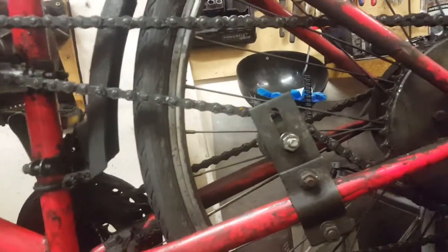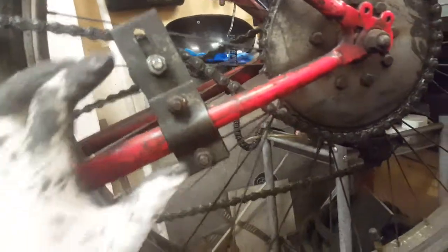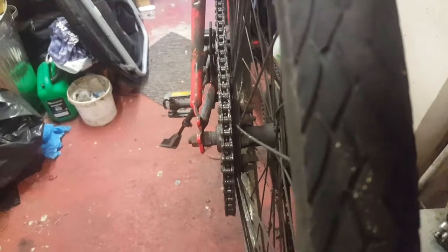What is the next? We have to pay attention. So don't push and go to tighten the chain idler. We have to find another thing. We go here, and this sprocket has to be in one line with the pulley. And what I see now, we have to bend it a little bit, just a little bit more. Okay, I don't know if you see here, but for me it's perfect. This is very important.